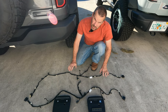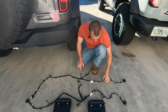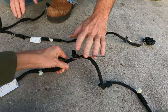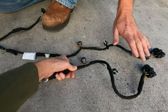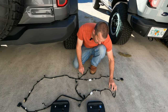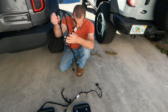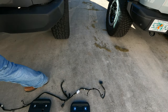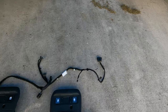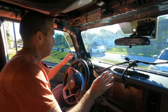This is just the interior components we need to change out — we're going to go ahead and throw them in. When I told you about orientation: this right here is the orientation on the passenger side. So make sure when you wire this up, this goes on the passenger side, because you can put these on the other sides and it might not work. Make sure the wire that goes to the passenger side up above the visor stays on the passenger side — don't swap it.